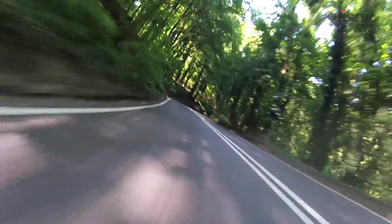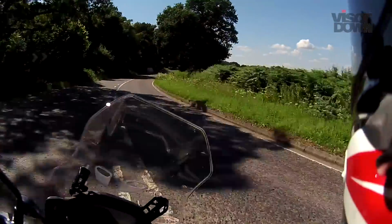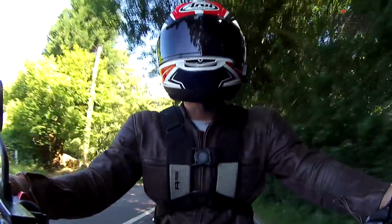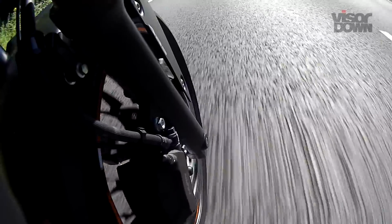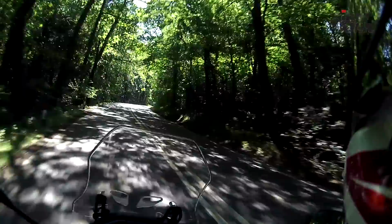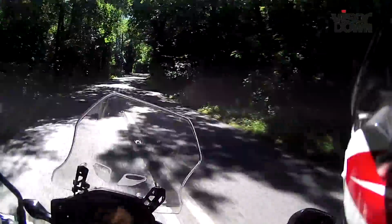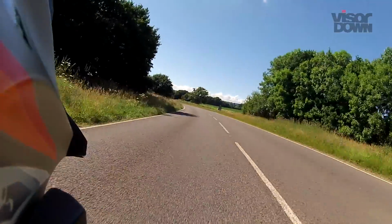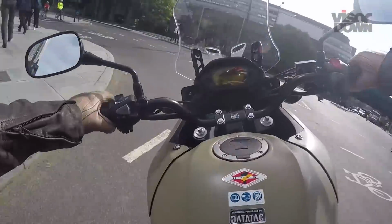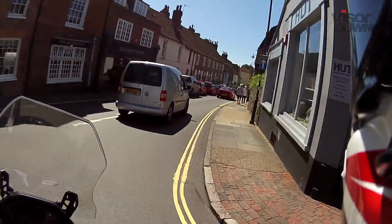On fun, twisty roads, maintaining momentum requires the right gear and revs, with optimum power sitting between 5 and 8,000 RPM. And the engine works in a similar vein to the CB500X's ergonomics. It's an ally, and although it sometimes needs to be worked hard, it is capable and willing and responds smoothly and predictably. It's got enough about it to make the 500X fun on a country road, functional on a motorway, and there's enough shove to make it adept at carving through the city.